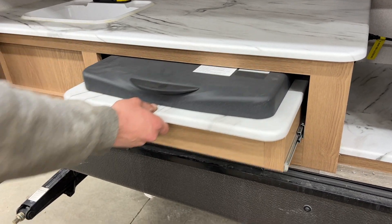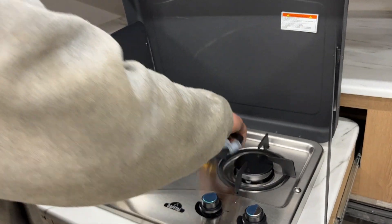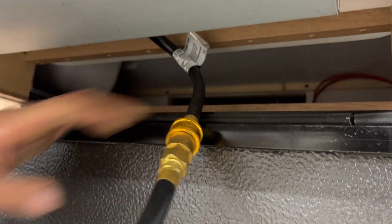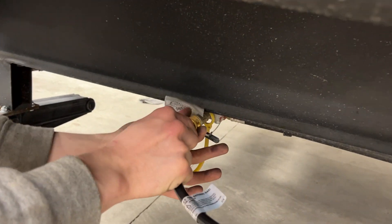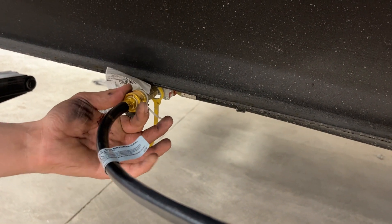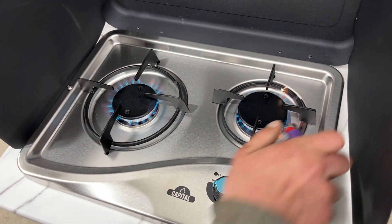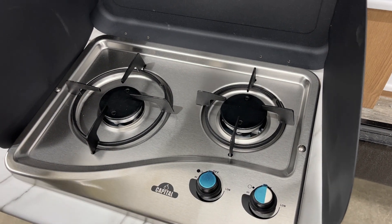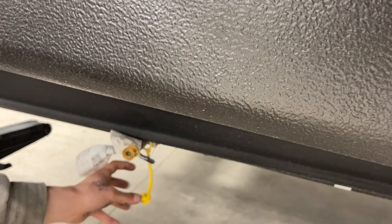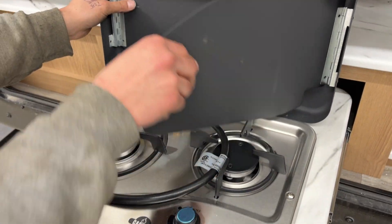For your exterior stove, pop that slider out and bring it out all the way, then bring it back in — that'll lock it open. Open it up and bring the wings out. Grab the hose here with the quick connect collar: pull that back and undo it. Underneath there's a little pigtail to attach to, and down at the unit you get a quick connect — pull the dust cap out, push the collar back, and attach your hose. There's a valve here: with that valve closed you can't undo the collar; with it open you can — it's just an added safety feature. Once it's all hooked up, turn that stove to high, hit it with a lighter, and she fires right up. Once you're done, turn it back to off, let it cool, close off the propane flow, undo the quick connect, stick the dust cap back in, and attach the hose to itself to keep things clean. Tuck it in with the quick connect in the back, loop the hose around, and store it right in there.